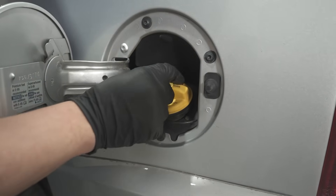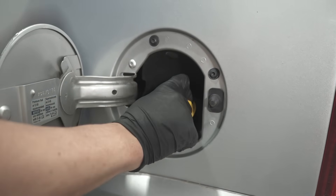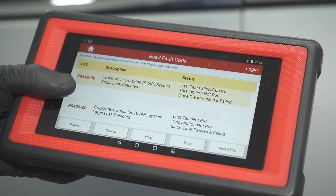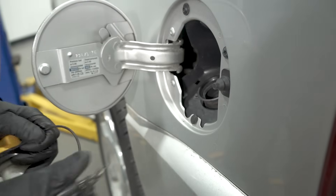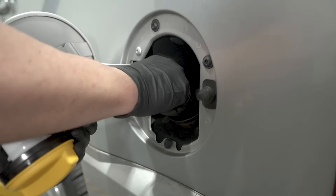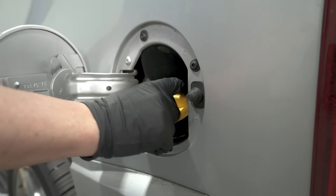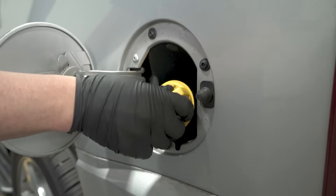For this gas cap — every gas cap's a little bit different — but you should get a click when you turn it, and it's really not clicking properly. It should be able to cinch down and that's not happening. Whether you have a small leak or a large leak or even some other type of EVAP issue, it's always best to check the gas cap in case it's something simple. With the new gas cap, slide it in the spot — and that's how it's supposed to tighten down, just one click for this vehicle. You may have a ratchet style, and if the ratchet style seems weak it's not gonna tighten down properly, but this works a lot better.